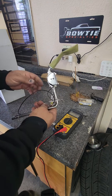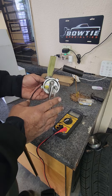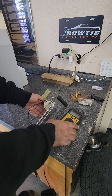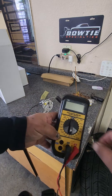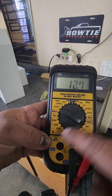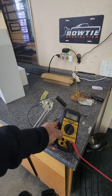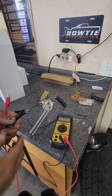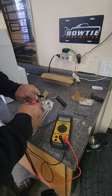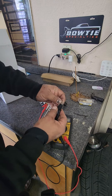We're doing another fuel sender test on a GM car — typically the 60s and 70s era, they're 90 ohms. We're gonna grab our volt-ohm meter, switch it over to ohms to see the resistance. We're gonna set it to 2k, then take our positive probe and put it on the sender here.